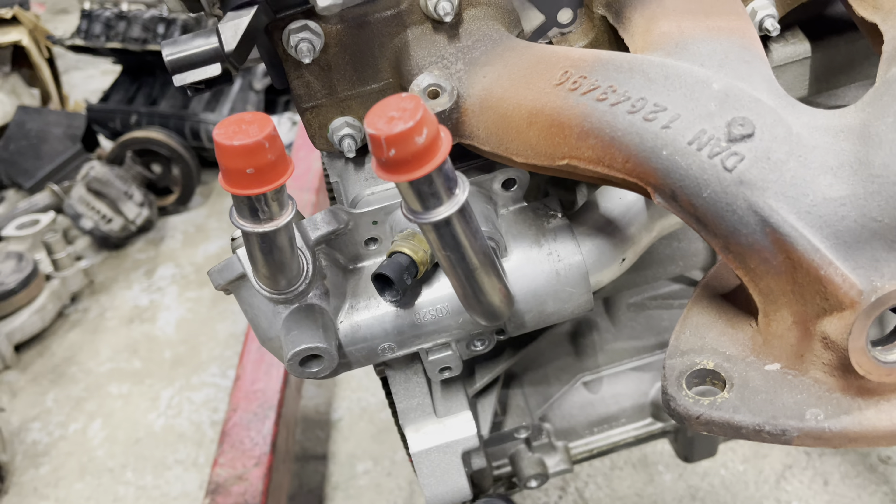There is an O-ring that seals this tube off here, and there is another O-ring that seals the pump off here. If your pump kit does not come with those O-rings, I do recommend replacing them regardless — even if they still look okay. If that pipe is leaking, it's a pain to pull it all back apart, especially when it's in the car. A couple of bucks for two O-rings. There is also another ridged O-ring that sits behind the water outlet housing right in here.